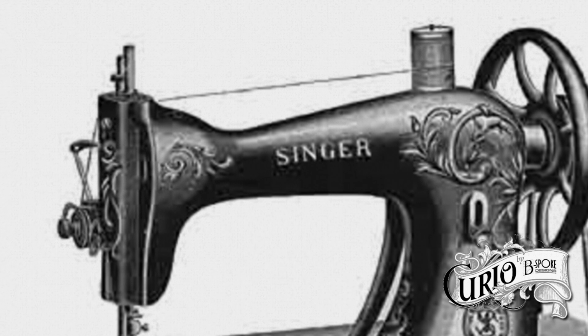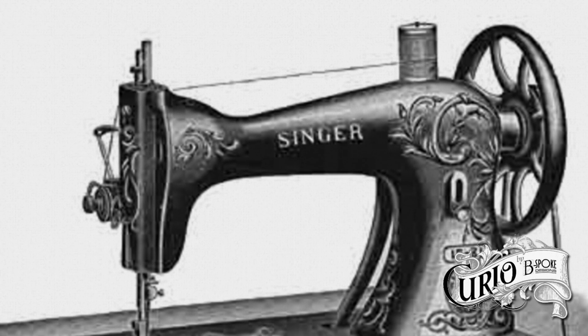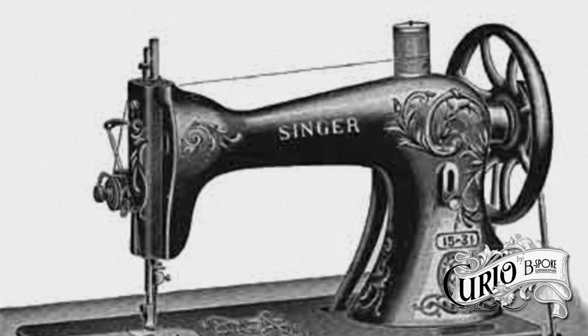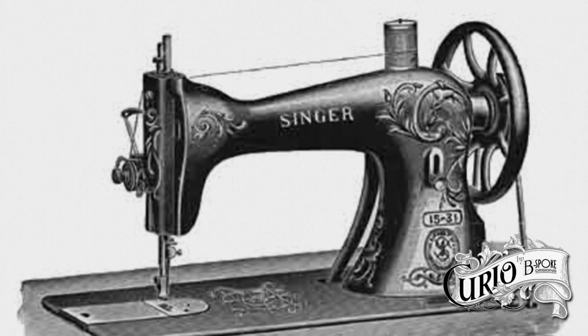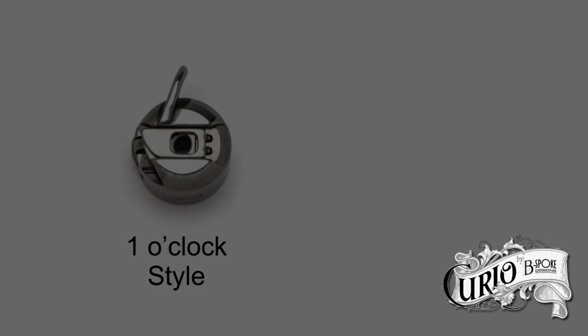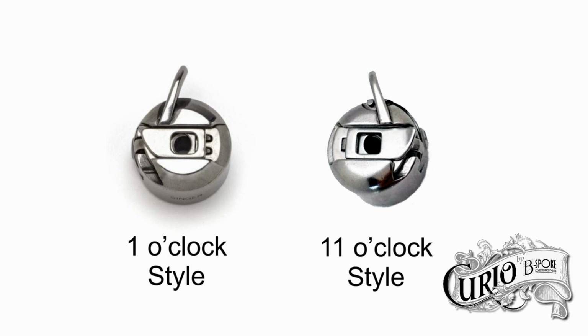Most Singer 15s are unusual in that the needle is threaded from right to left. However, the 1530, along with the 1580 and several other designations, thread the standard way from left to right. These machines also had a different bobbin case, often referred to as the 1 o'clock style case, where the right to left threading machines had an 11 o'clock bobbin case. This referred to the position the bobbin case's finger pointed.